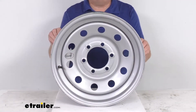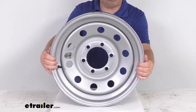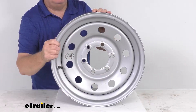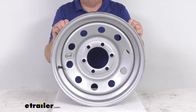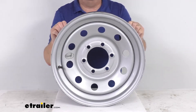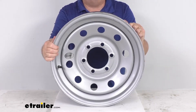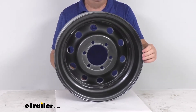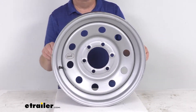This is a heavy duty sturdy steel wheel with the modular design — that's the one that has the round holes that go around the whole wheel — and a nice silver finish. The finish is a silver acrylic enamel finish, which resists chipping and other damage better than standard powder coat finishes. This finish is applied after a zinc phosphate pre-treatment and covers an e-coat primer layer.